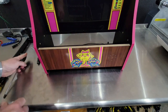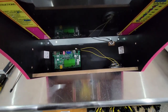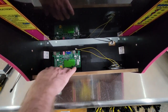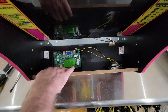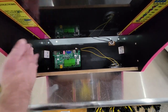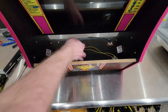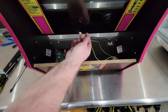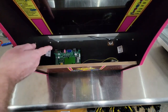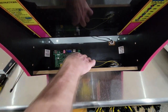Screw that down at the end, it'll look like that. I pushed it up all the way against this right here because the back doesn't need to be accessed at all. And that'll give you a little more room up front. So push it all the way back, and I would do it on this same side that I have it on. And what you'll want to do is go ahead and take the speaker. You can go ahead and plug that into the 2-pin JST that's right here.